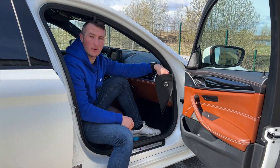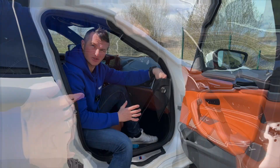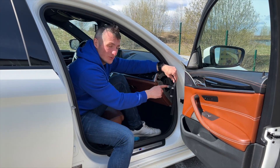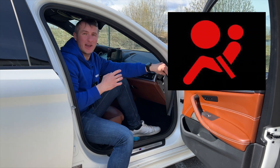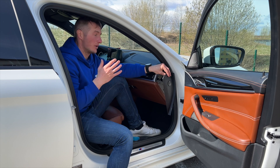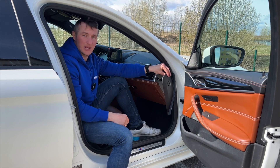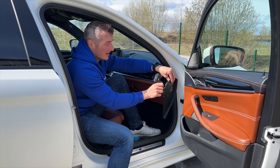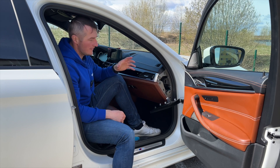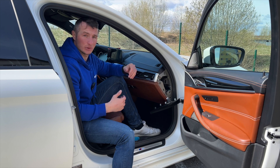One very important remark: you can see that part over here — this is the switch to disable your passenger airbag. Over there is a connector. If you do disconnect that connector, your airbag warning light will come on, and you'll be unable to erase that without any special tool. You'll need ISTA Plus in order to clear that, so please just leave it hanging there. For this job, you will not require any special tools. If you did disconnect it by mistake, please contact me and I can help you erase that error remotely.